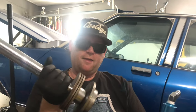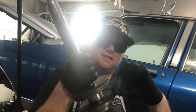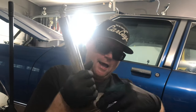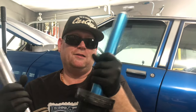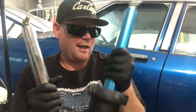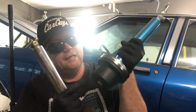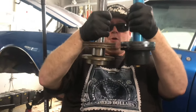This is the old cylinder setup that was in the car. It has the shallow cups and you'll also see this big space in here. This is good for once your springs kind of press down a bit and they're broken in — it gets your car back up a little bit again. I was running three donuts on that. The problem was the Black Magic cylinders are obviously much bigger in diameter, so the holdup was waiting for these donuts. Also you can see the deep cups will allow the car to sit a lot lower looking at that.